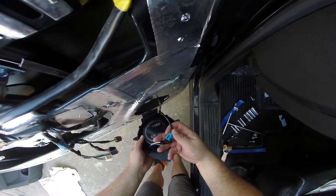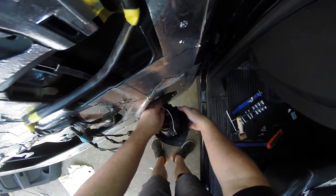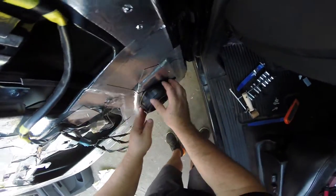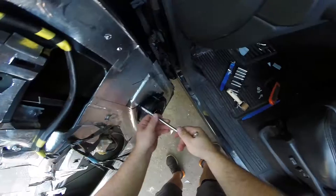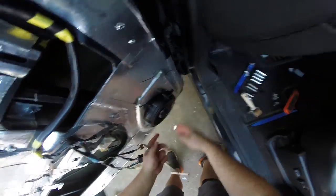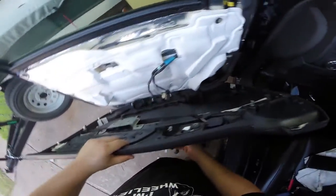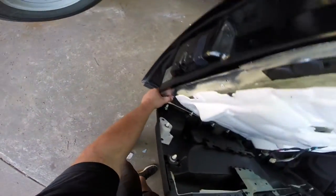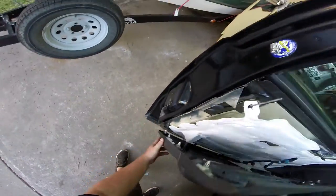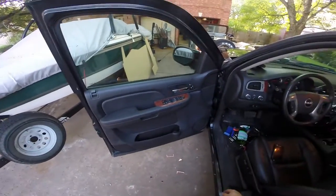With the GT Mat applied, plug the wiring pigtail into the factory harness inside the door, mount the speaker in the adapter bracket, and stuff the wiring inside the door. If you prefer, you can also add two self-tapping screws to the bracket for extra security. Once everything's in, punch through the mounting holes and the door goes back together with the speaker installed.